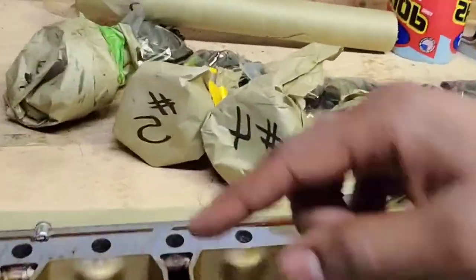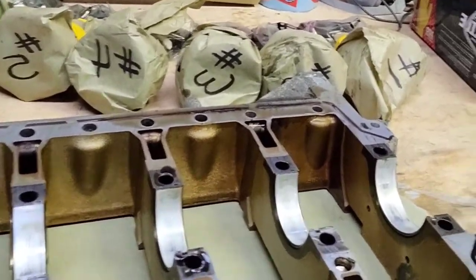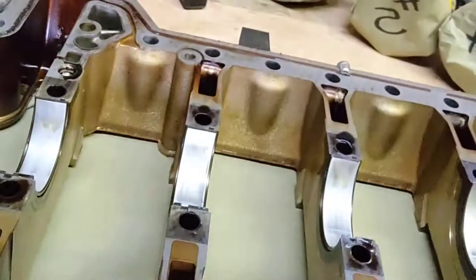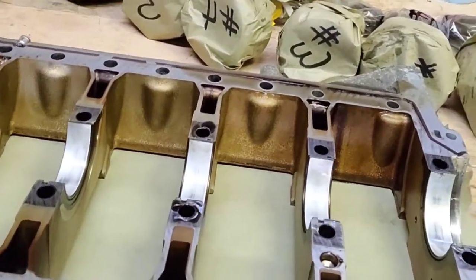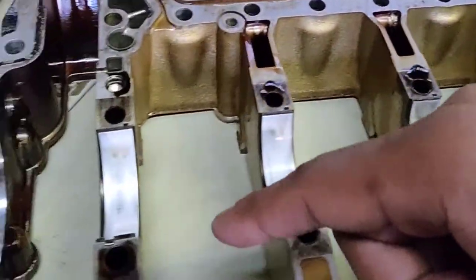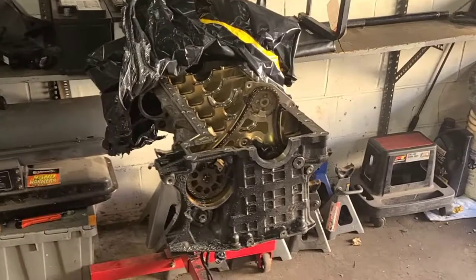Here's the bed plate and you can see where that little injection nozzle goes on both sides. You actually force a sealant and it flows around in this channel — it seals the main rear and front crank seals. It also has that little nozzle right there. You can see the bearings are not that bad. Stay tuned for the next phase of the teardown.